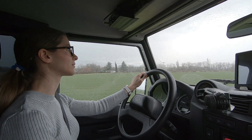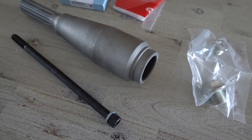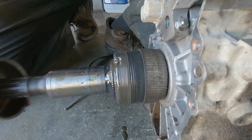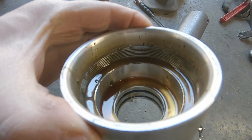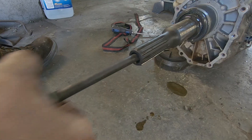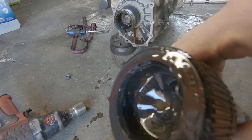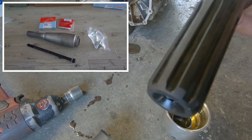You know it's too late when you hear the loud clicking in the driveline when changing gears — the famous clunk or clunking noise. It's even amplified if your drive shaft flanges are worn out. How to fix this issue? Replace the output shaft kit. Some companies like Ashcroft Transmissions have been selling a kit to fix this problem for several years now. We installed the Ashcroft Output Shaft Kit in 2016 — it's very well thought and well manufactured. We were very happy with it because it completely stopped those slammings in the transmission. The principle of their kit is clearly explained on their website. So I replaced it for the LOF Extreme Spec MT-82 Output Shaft Kit.